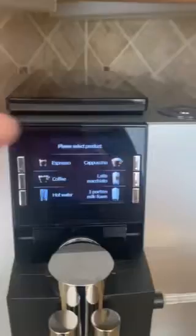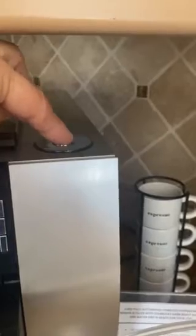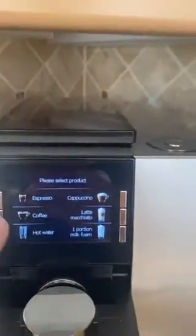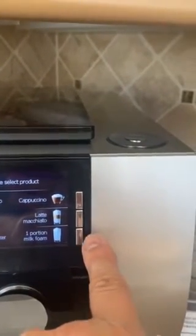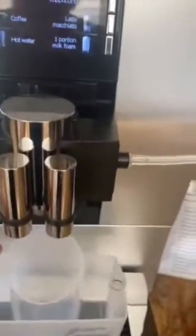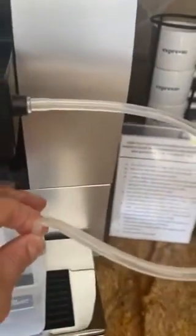When you're ready to clean it, you'll see a display that says 'clean milk machine.' Hit this button and it'll say 'ready to clean.' Hit it again to confirm, and further instructions will appear. To be ready to clean, you will put the cleaning canister under the spigot, detach this from the milk carafe, and put the milk carafe with leftovers in the fridge.